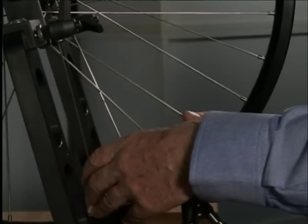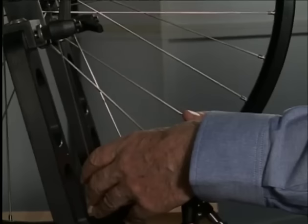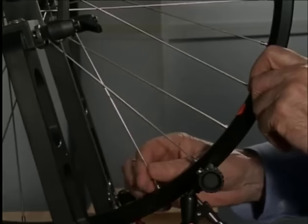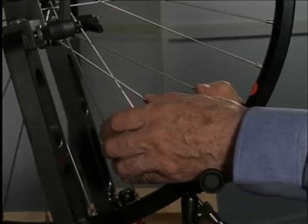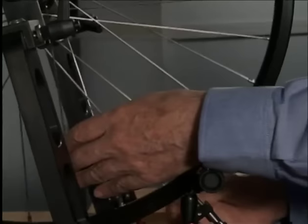The wheel has been pre-trued, but the spokes are not yet straight to the rim. The bad alignment or position of the spokes will result in a run out of the wheel after several kilometers and will need to re-true later. To straighten the spoke to the rim, we need to do the following.